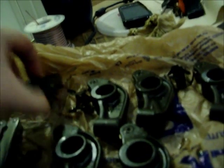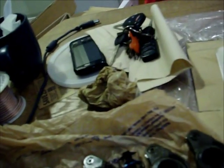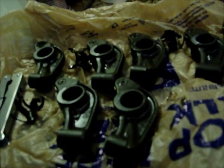This actually needs to rotate that way - kind of keep them all in order. And these rockers, they tilt left and right, so there's a B - some of these say BG6 and some of them say AG6, and they alternate. So one tilts to one side and one tilts the other side. So they're actually keyed for a certain way.